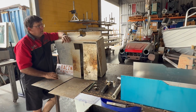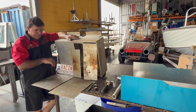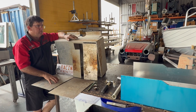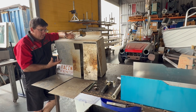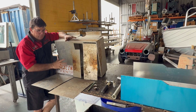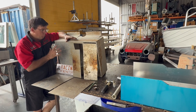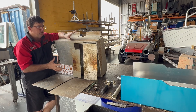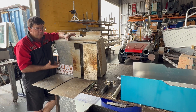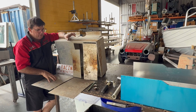We have lots of dissimilar metals: brass, copper, stainless steel, steel, and galvanized steel. Galvanized steel is probably the worst one — it won't rot away because it's galvanized, but the sacrificial anode for the galvanized bolt becomes the boat or tank. Whatever you're using, if it gets wet, it creates an environment prone to electrolysis and this corrosion problem.